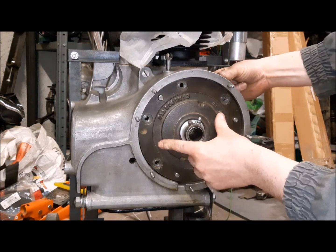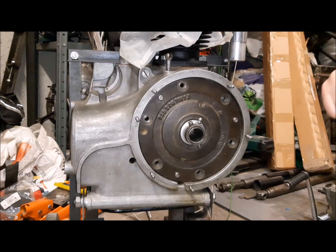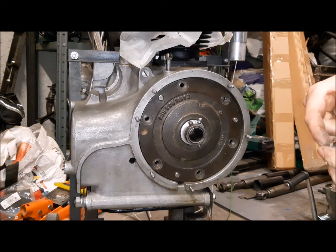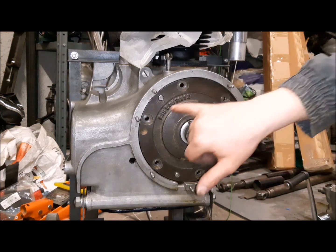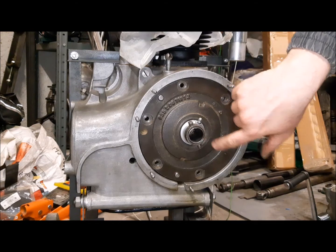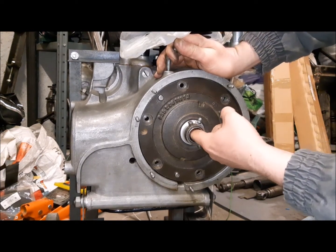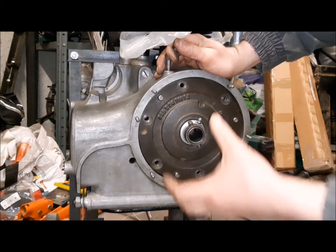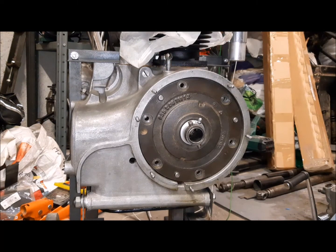I think I will call somebody to help me, because it will be much easier to make the assembly. It is important to put the nut not too tight. After you put all the nuts, you make an assembly with the gearbox in order to put the clutch disc in the center. You pull out the gearbox, and after that you can tighten the nut for all the bolts on the clutch system.